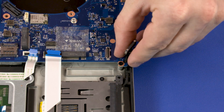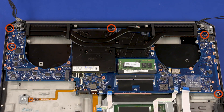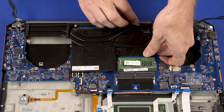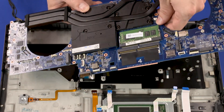Remove the storage drive cable from the notch in the system board. Remove the five 4 mm P1 Phillips-head screws that secure the system board to the top cover. Grasping the system board near the center, carefully lift the right edge off of the alignment pins and slide the external connectors on the left side out of the cutouts in the top cover. Remove the system board.